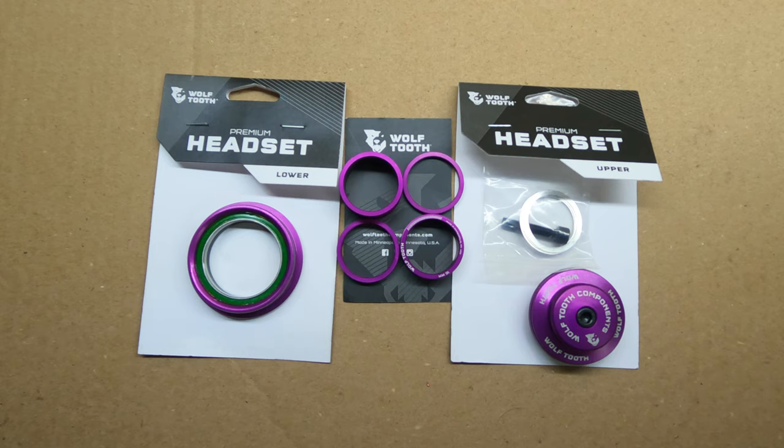I did notice that with my bike in particular, the headset cups are made out of plastic. I don't know if it's ABS plastic or what type of plastic it is, but they're definitely plastic. The issue I'm having is this creaking gets worse for a while, and then I'll take it apart, re-grease it, put it back together, and it gets worse again. The last time I rode the bike this past week, the actual cup on the lower part of the head tube is popping out. I'll show you guys in a video a little bit later what I'm talking about.